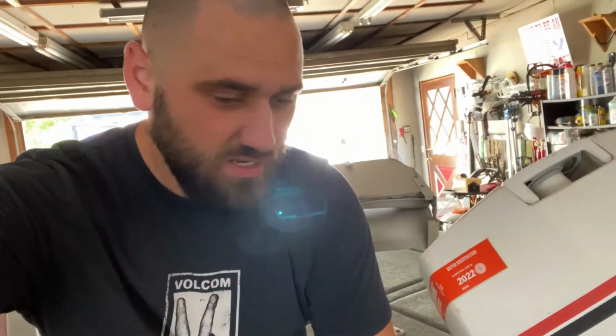To get this thing running was actually a bit of a project on its own. It would start on the hose perfectly fine. I never had any issues. I would hook up the muffs, fire it up, no problem. I'd drop it in the water, crank and crank and crank until my battery's dead. It'll fire and then die. It'll fire for a second, and as soon as you throw it into gear, it dies. I couldn't figure it out for the life of me.